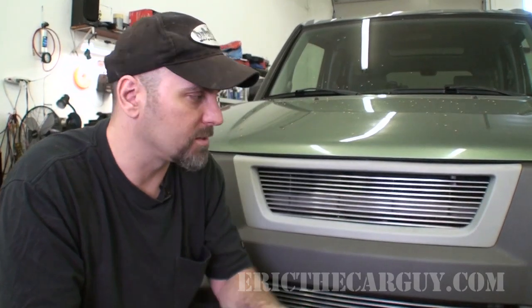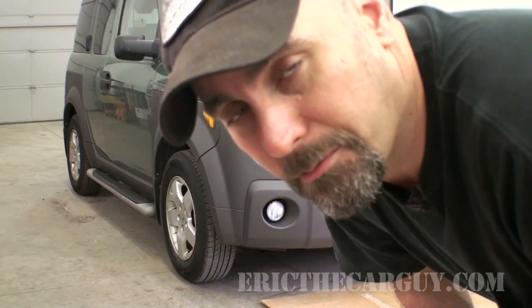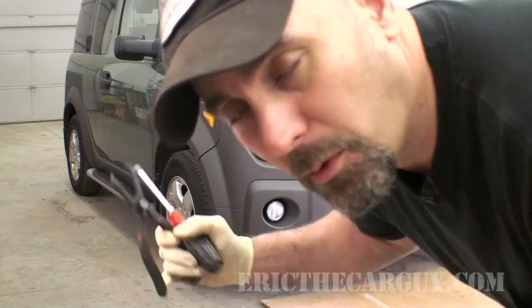So why don't we get started by removing this front clip. I'm going to do that first before the performance test, because obviously that's going to affect AC performance a little bit since the airflow will be different. I want to make this as accurate a test as possible. We'll remove the front clip, do an AC performance test, go out and clean the condenser, come back in, and do another test to see how effective it was. I've already shown removing this front bumper clip in other videos — I'll post links in the description — but we're going to breeze right through it so we can get to cleaning this condenser.